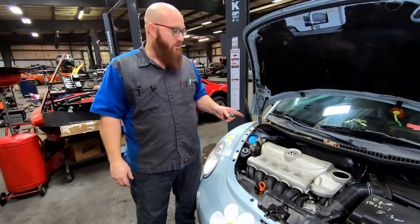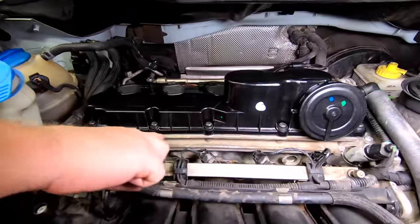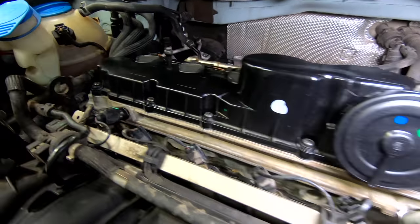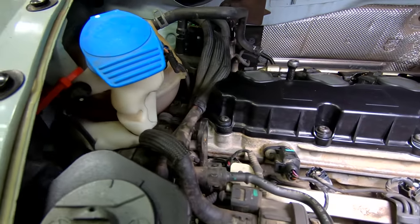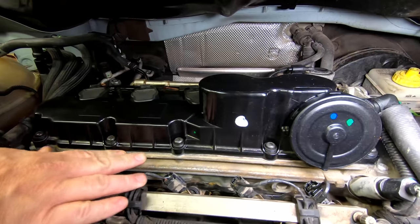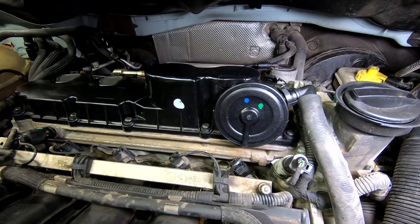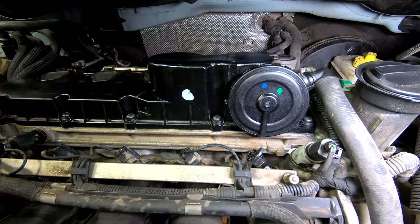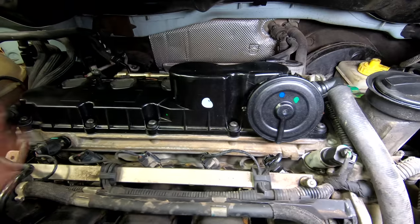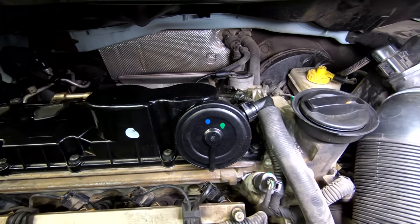There was a big oil leak on this car. Let me take this beauty cover off. It ended up being the valve cover gasket, which was leaking all down the engine block — it was completely coated. When we lift the car up you'll see we've cleaned most of it, but the customer should take it to a car wash and pressure wash the underside. We also checked these Volkswagen engines for crankcase pressure or vacuum, and out of this port there was just a solid stream of air coming out. The diaphragm was bad inside the valve cover. It was cheaper to get an entire new valve cover — it came with a new gasket, a new diaphragm, everything all in one. It solved everything.